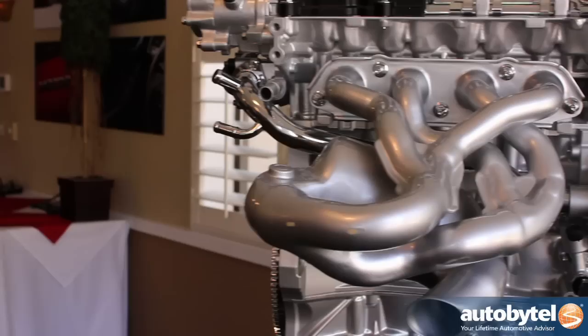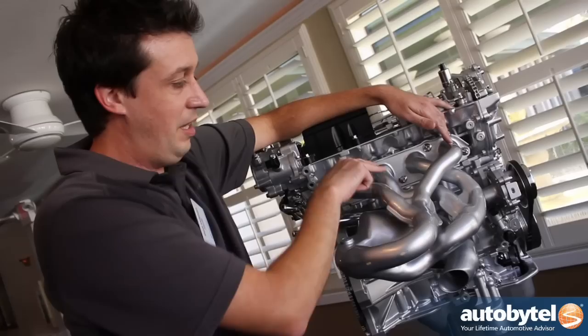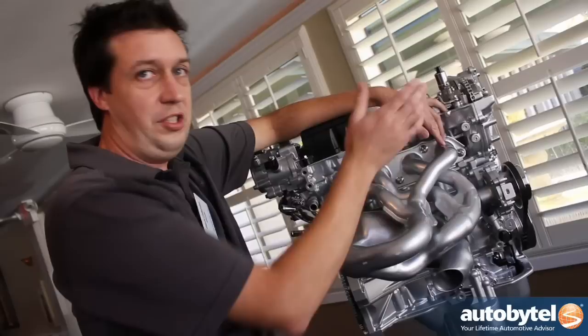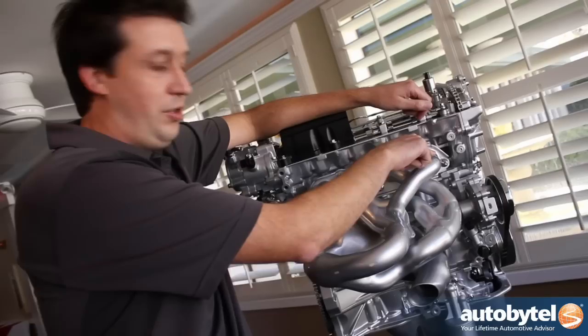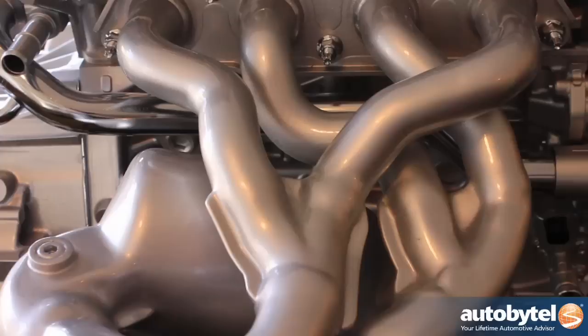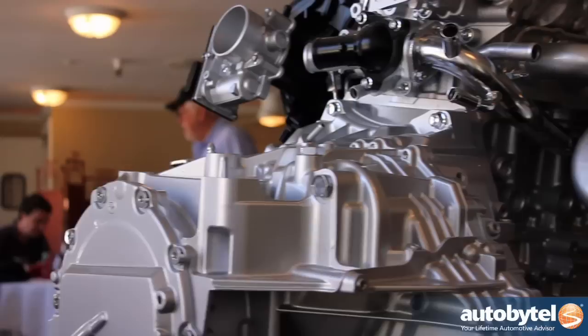What happens is there's a little bit of overlap between the number three and number one exhaust pulses — this one is just opening the exhaust valve when the other is just about to close. With a short manifold, the pulse coming out at the beginning of the exhaust stroke will come down and bounce back up the number one runner and actually push a little bit of exhaust back in there. That exhaust will heat up the next charge and make it more likely to knock. So by having this long, convoluted path between number three and number one, the pulse has to travel all the way down to the second collector and all the way back up at the speed of sound. The time it takes to travel that far means that by the time it actually gets there, the exhaust valve has closed and it can't shove exhaust back in.